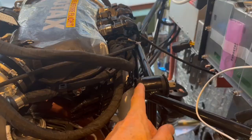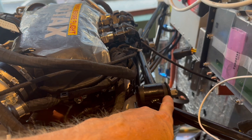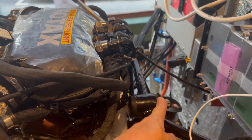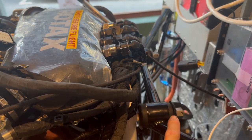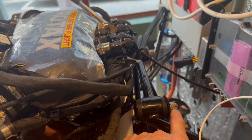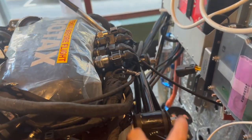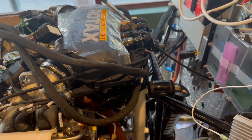Before you even think about putting the engine on the crane, get these rubber isolators, the steel cups, and the spacer sleeve that goes inside. Get them in the right order - the hard ones go on the back, top and bottom, on the front - and place them in the frame. Get a C-clamp or something and squeeze them together and push them into the frame. That way the bolt will be long enough to get a nut on. If you don't do that, it's quite a bit fatter and you won't be able to get the nut on.